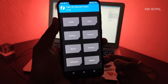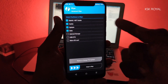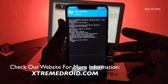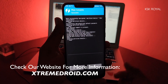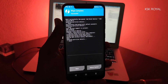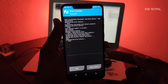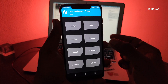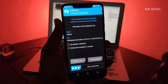Go to Wipe > Advanced Wipe and select Dalvik Cache, System, and Data, then swipe to confirm. We do this because jumping from Android 9 to Android 10 technically requires a clean installation. Although you can directly flash the Pixel ROM Android 10 edition, after booting you'll see issues like Google Play Services crashing due to incompatibility. Wiping system and data is necessary. Then go to the home screen, select Install, and choose the Android 10 zip file — the same process works for Redmi K20 Pro, Redmi Note 7, or whatever device you have — then swipe to confirm flash.